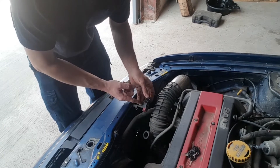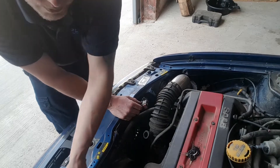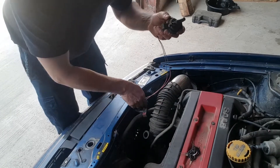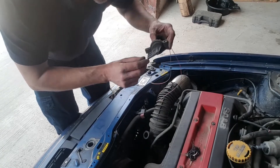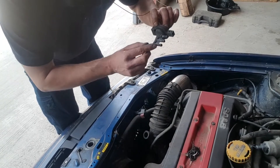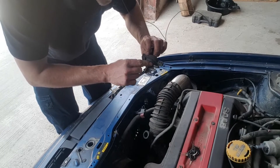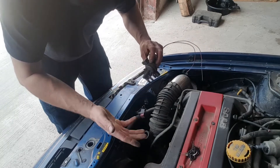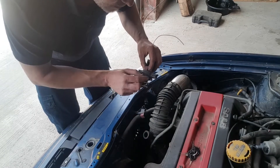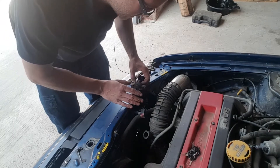You can cut this off and just bare the wire back, but I'll just leave that in. It's basically with T7 — all you do is swap your pipes over. C to compressor, W to wastegate actuator, and R to recirculate, which basically goes back into the turbo. But if you've got an upgraded turbo which hasn't got that feature, it doesn't matter — you can leave that to atmosphere, it's not going to hurt. Basically, we'll get that planned in.